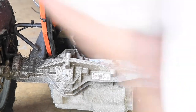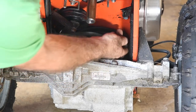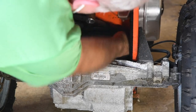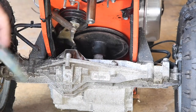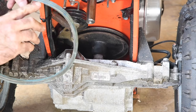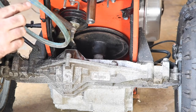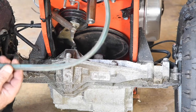I'm going to do this with the hand that doesn't have my watch on. I take the belt and roll it up over the top of that pulley. The belt number is 4LK350, which means 35 inches around the outside — the AK-33 means 33 inches around the inside. This is the belt I talked about from Amazon and you can see I've been using it a while and it's still in pretty good shape.